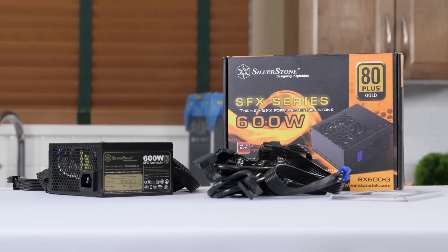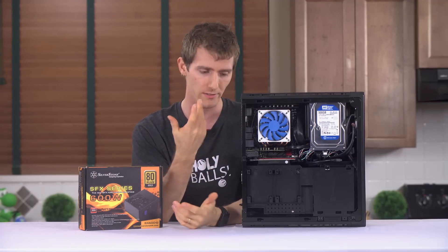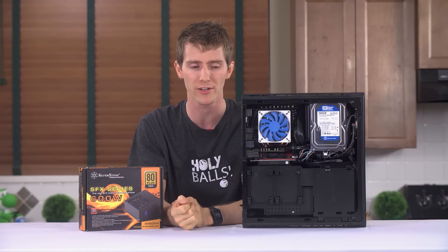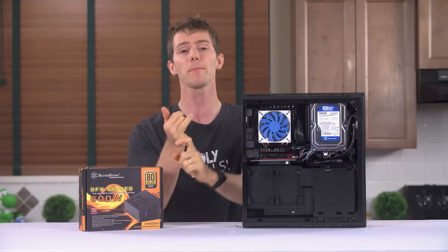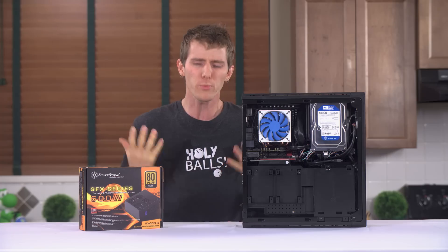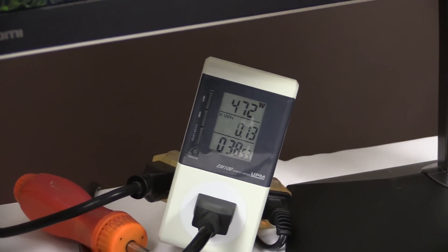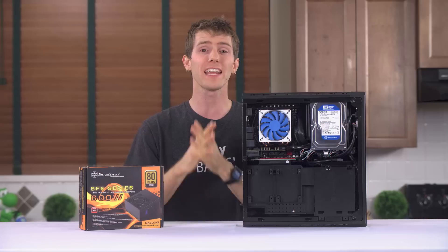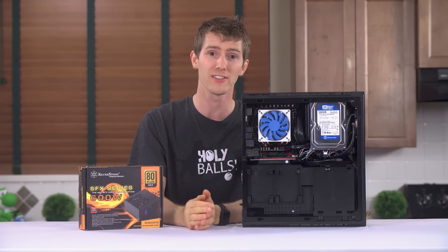So what's the conclusion? Well, we went with a 4670K, overclocked it to around 4.6GHz given the compactness of our CPU cooler, and overclocked our GPU as high as we could go without artifacting. We fired up Prime95 small FFTs and Far Cry 3, and the most we could get as sustained load was about 480 watts from the wall — meaning the power supply was only working at just over two-thirds of its total capacity.